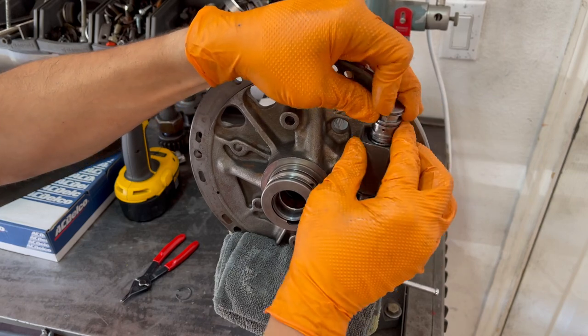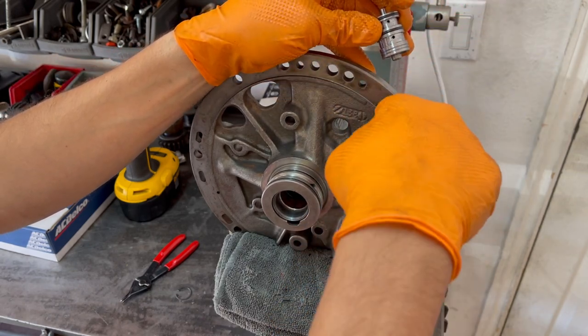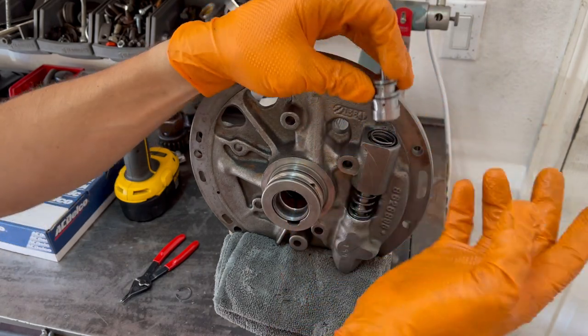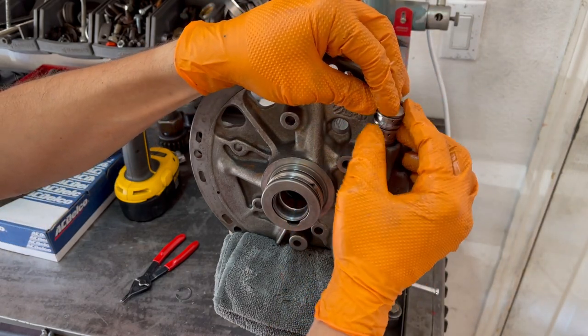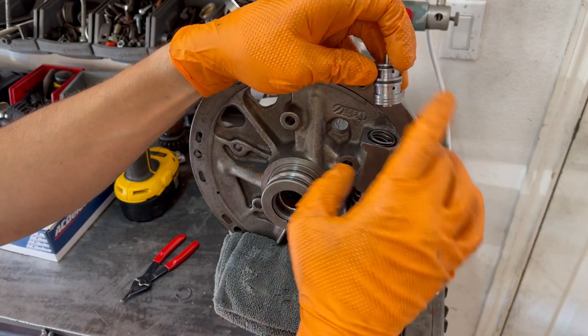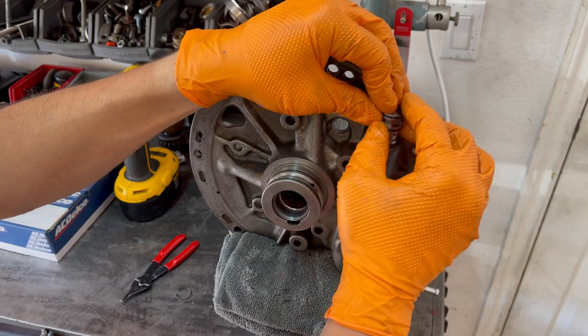You want to make sure that you lube the inside of the bore up really well — I use the blue assembly lube, whatever assembly lube you're using. This way you won't cut the rings. Also check and make sure there are no burrs or anything else that could cut the rings.